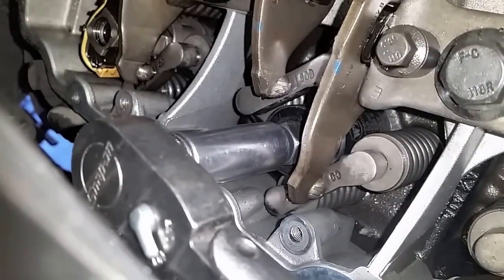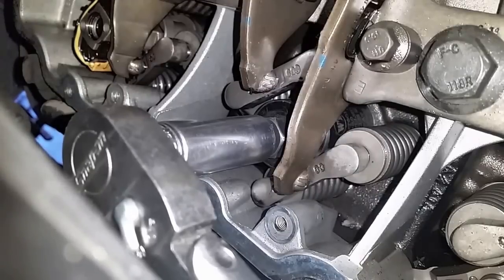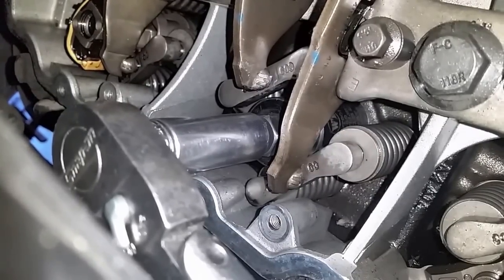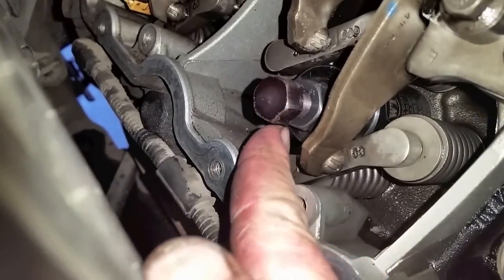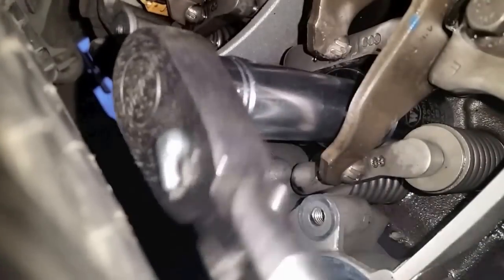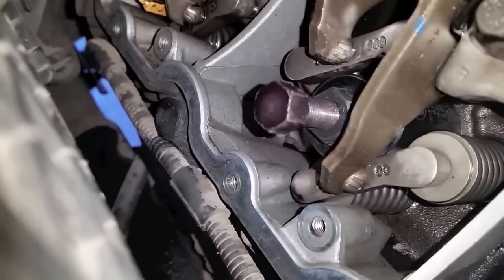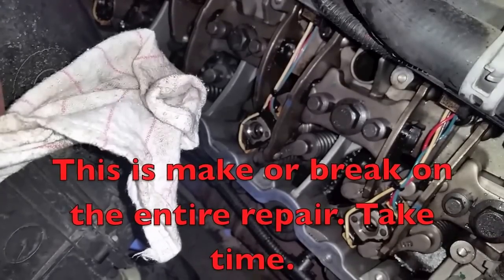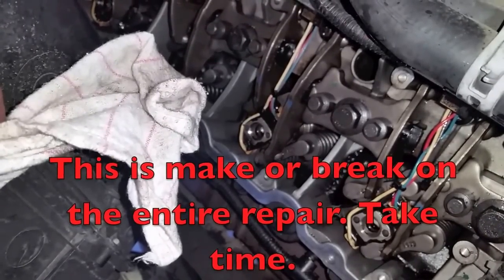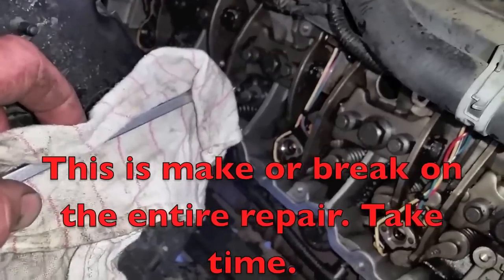We're starting to get some real resistance. Note that the coolant was already drained previously when I was doing the pressure check. You want to make sure the coolant is drained so you don't get a bunch of water into the cylinders. Switching from the 9/16s that I was using to drive the tap down into it, to the 11/16s to turn it and pull it out. It's extremely important that the bore is completely clean — use brake cleaner. Make sure there's no coolant or anything inside the bore; I'm taking a screwdriver and a rag and wiping it out to make sure it's clean.